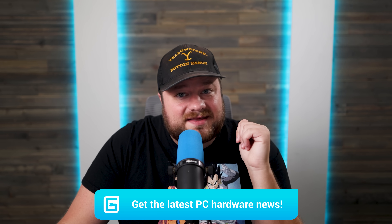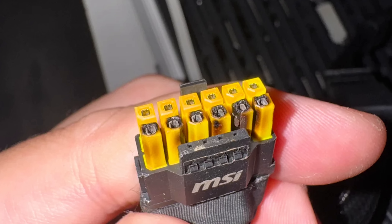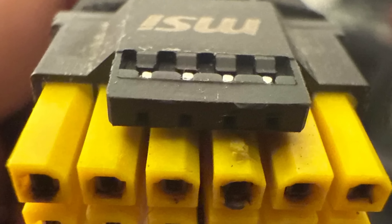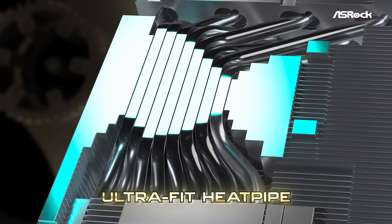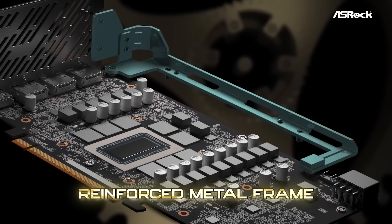And while you're at it, go ahead and hit that subscribe button, because unlike these connectors, Gamer Melt won't melt under pressure. Either way, you want to check your connector because I now have five new cases of burned connectors, with one being a 9070 XT. Lower power draw doesn't always mean you're safer — this is actually the second 9070 XT from a completely different manufacturer.